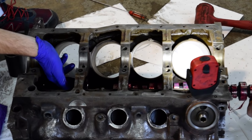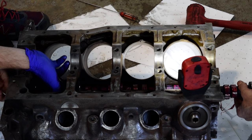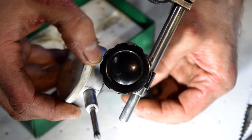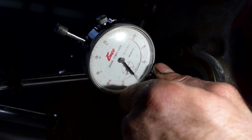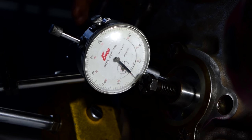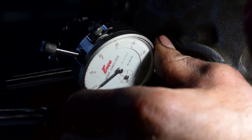I was able to grab the shaft as Bruce feeds it in. Once a camshaft is in, you need to measure it to make sure it's not drifting too far left and right. Bruce measures it using a tool to check how far it drifts in and out. He tells me some people put cams in and skip this step, so what they get is a camshaft dancing all around the place causing wear that it shouldn't. He finds it's still out of spec a little bit and uses a padded hammer to tap it left and right until it's sitting perfectly, because once it's in, the timing chain will hold it in place.